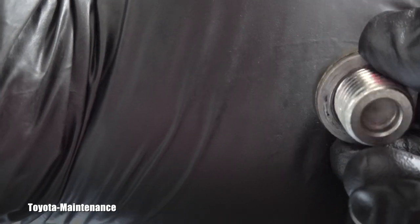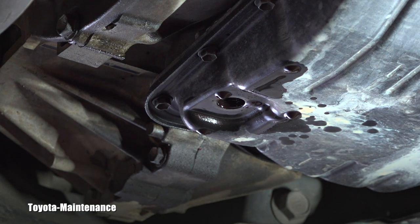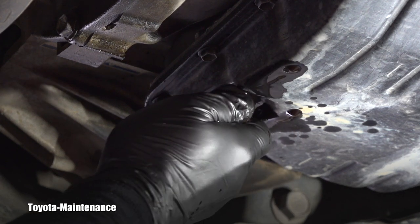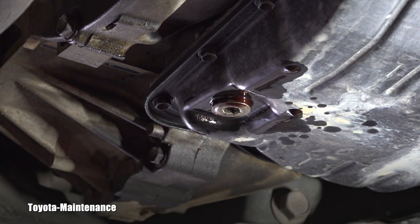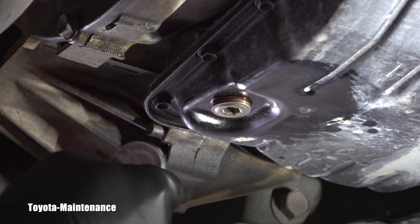Here's the detail of the plug. You can see the crush washer, which should always be replaced. I'm putting it back now without replacing it — and here's why: I'm doing a flush and will repeat this procedure twice. There is more fluid than I was able to remove, so I will fill it with new fluid and then go for a test drive, mix up the fluid, and drain it one more time.